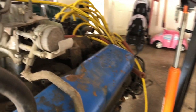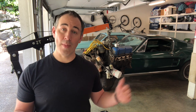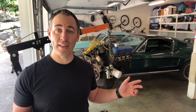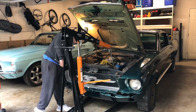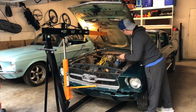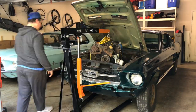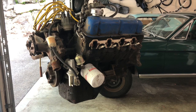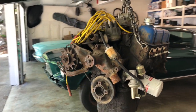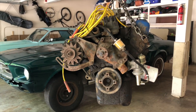You really don't have to pull the motor to find the casting numbers on the engine, but if you do pull the motor it's a lot easier to find and locate the numbers on the actual engine block. I pulled this motor out last weekend and things went pretty smoothly. You don't actually have to pull the hood off of the car to get the engine out. Pulling this engine was pretty easy because it was never wired up to the car. I only had to remove the motor mounts, the trans brace, and pull the radiator to give a little bit of clearance. Once that engine was clear, it's easy — pull it out, piece of cake.